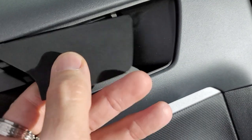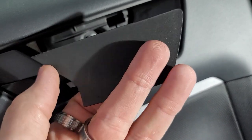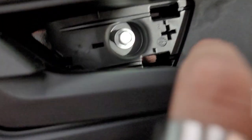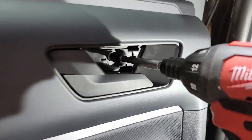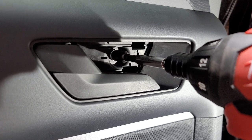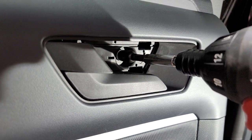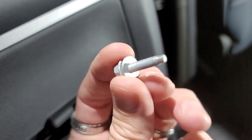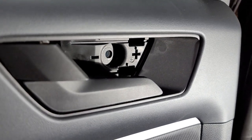This piece right here is a nightmare because it is so tight — there's no easy way to get it off. What I did was push really hard right here and it popped this part back with the two clips on it. I'm not going to say that's the right way or it'll work every time, but you have to get to this bolt back here. Believe it or not, it's an 8mm. So you've got 10mm, 7mm, and 8mm — Ford is notorious for that. I mean, you couldn't just use one size bolt? Ford, for God's sake, stop doing this — you've done it for years.